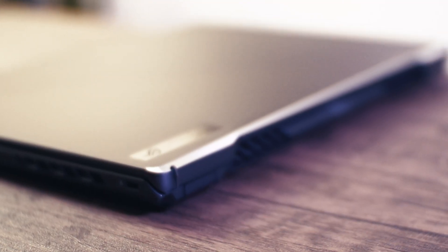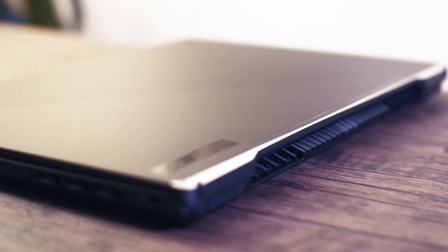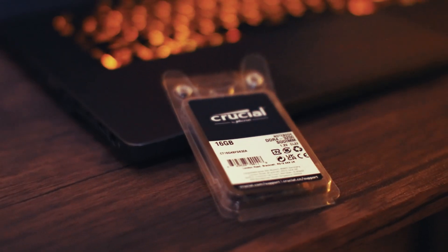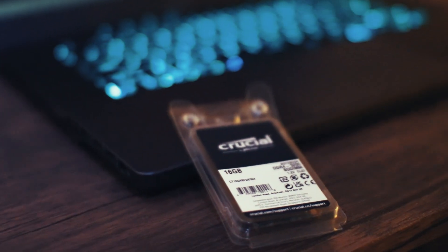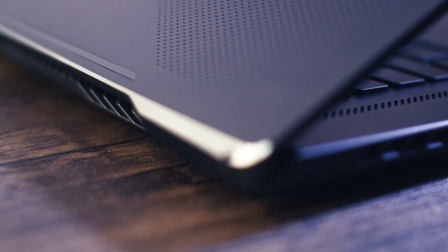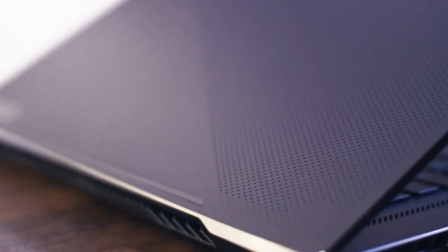What's even crazier is that in games, it actually helps your performance by increasing your RAM, even when it's mismatched. It's not much, but it is a measurable difference, which I'll show you in this video. I first tried this out by ordering a 16 gigabyte stick of dual-rank RAM from Crucial for a total of 24 gigabytes in my system. Most of my games don't ever use more than 10 gigs, so I wasn't expecting a performance improvement, but I was testing this when Jared's Tech put out his RAM video with very similar conclusions. There's also dual-rank versus single-rank and native resolution versus 1080p to consider, but I'll get more into that in a little bit.